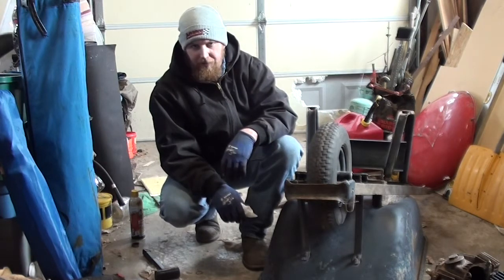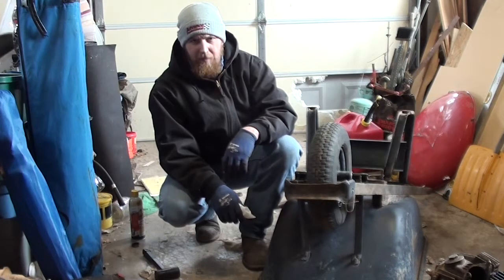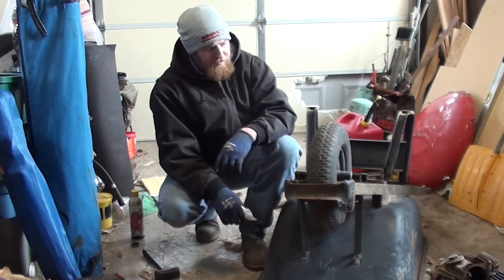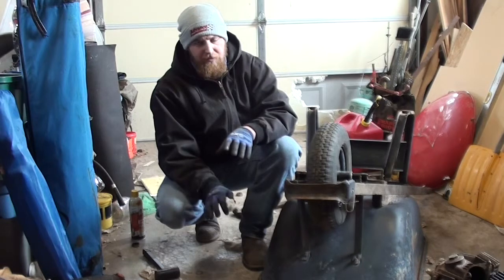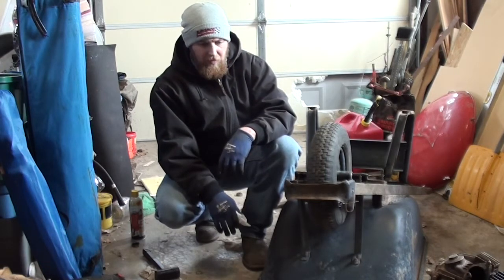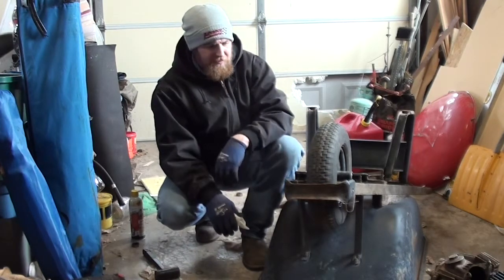Now you have a better idea of how to use this Flat Stop and you can see how off-balance it's made this tire — it's all sitting down at the bottom. That's part of the big reason I don't recommend using it on the road. Especially on newer vehicles — I don't even recommend Fix-a-Flat because of the TPMS sensors. If your vehicle has tire pressure monitors, do not use any kind of flat stop because it will destroy those sensors, and those sensors are about $80 a piece.